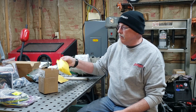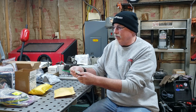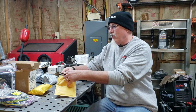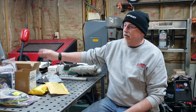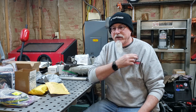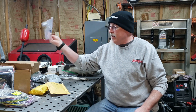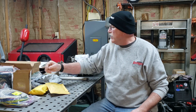I've got 42 lb injectors, so that's 440cc, which should get me to the power levels I'm looking at for this engine. For the fuel lines, you can use 5/16 to AN6 compression fittings and they work great. I've got connectors for the injectors and coil packs — the coil packs I'm using are the red-top Audi/VW R8 coils. Also have cruise control solenoids, a knock sensor, an intake air temp sensor, and a Bluetooth adapter, since that's one shortcoming of this ECU — it's not natively Bluetooth.